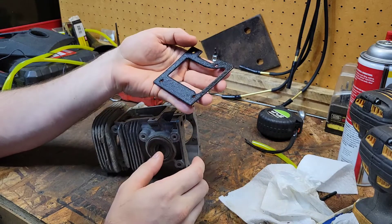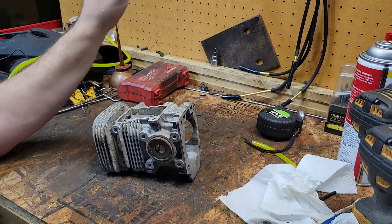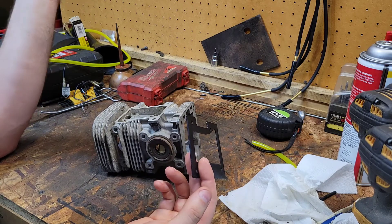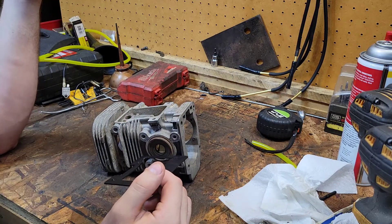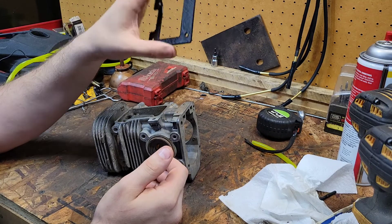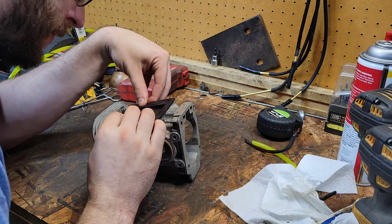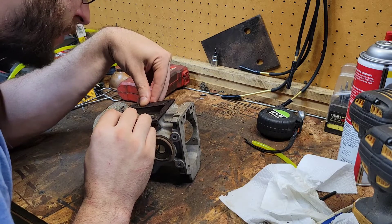It's super flexible, I'm pretty sure it's reusable, and it handles heat and chemicals. I would not use it as an exhaust gasket — that's a no-no, there's a reason you don't see these used there. But for an intake setup it's going to handle it just fine. I've seen others start using these. We're going to revisit the 790 McCulloch 101 and rip the tank off again and put this in place. If the D-port isn't deep enough I can always adjust the program, reprint it, and get another one on it.